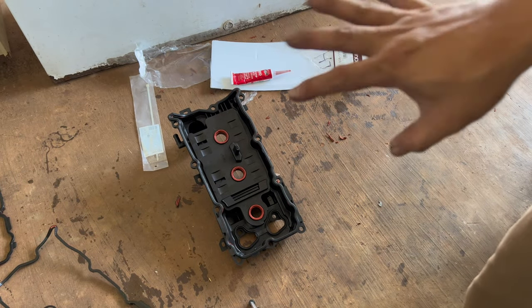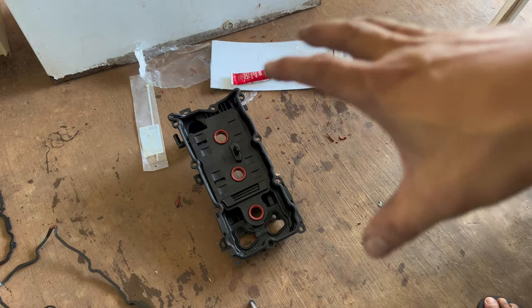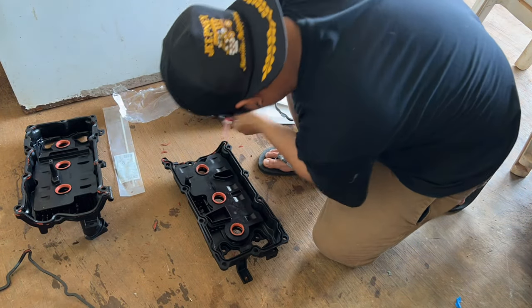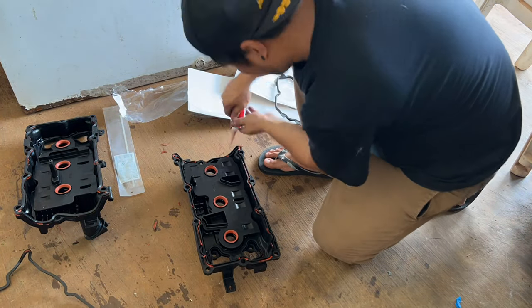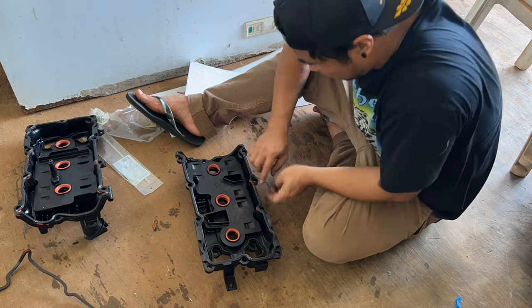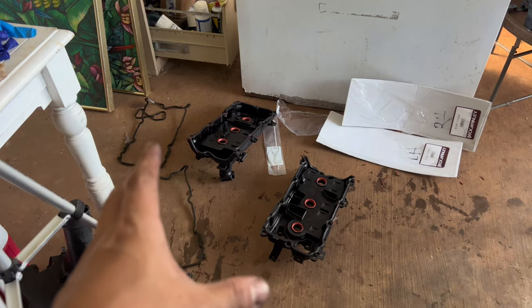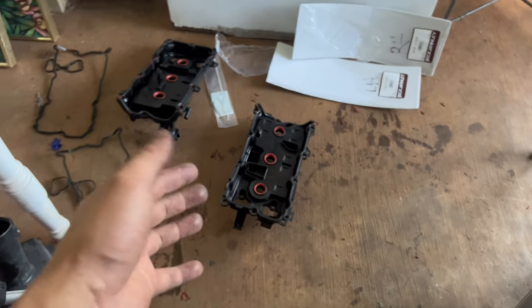Kind of a crazy video — a lot of fast forwarding. The biggest challenge you're going to have is those wires, the wiring harnesses, removing all the connectors, and the bolts. I hope you saw that diagram of how to tighten it, and the foot pounds — 6 foot pounds — if you're going to torque the valve cover. Also the little tip about tapping the valve covers instead of rubbing your thumb on the seal. I hope those things help you. I don't see really much Infiniti 2010 FX35 videos about how to change out valve cover gaskets, so I'm hoping this video helps you get the lowdown of what I did. Keep commenting below — I answer all comments regardless if this video is old.